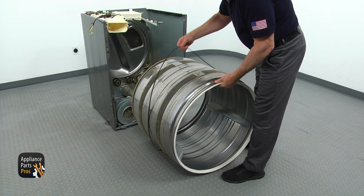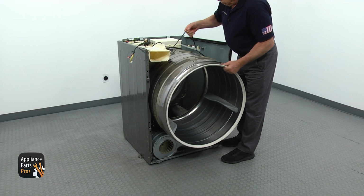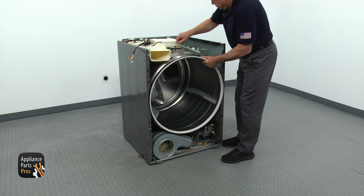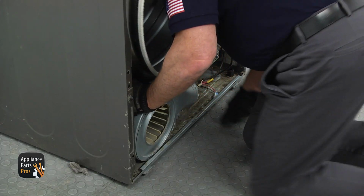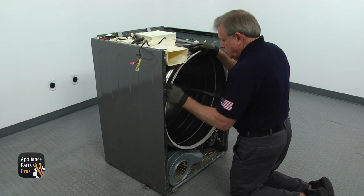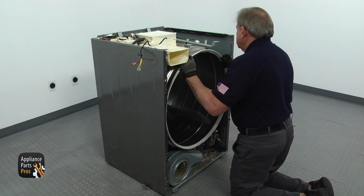Place the belt on the drum with the ribs inside. Install the drum inside. Make sure that the rear edge is on the 3 rollers. Place the gloves on and dive under the drum. Loop the belt over the idler pulley, push the idler pulley up, and install the loop over the motor pulley. Slowly turn the drum 1 full turn manually to check the belt position.